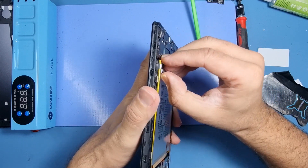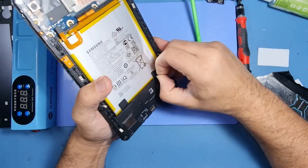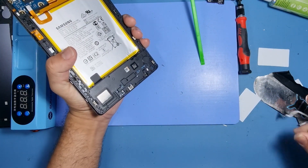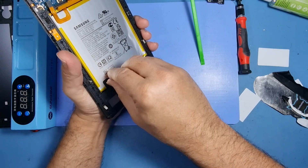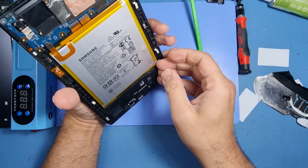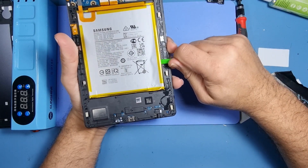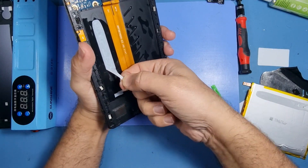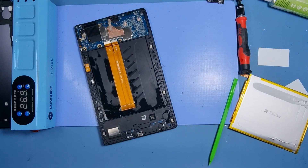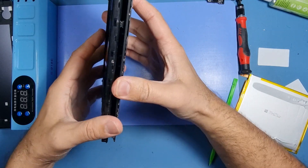Got a frame here to remove — this frame needs to come out. Let's disconnect the battery and also disconnect the connectors for the screen. Got a few screws here to remove. The video is a little bit long, I suppose, but when you're doing it, you kind of will avoid some of the pitfalls that I've come up against — so it'll be a lot easier for you to repair. Disconnect the battery — don't use metal. Use a plastic spudger tool or something that's not going to damage anything. The battery is bonded in. Use a bit of alcohol just to get in there. I think these pads — if we just pull this tape, we can just pull out the battery. That will release the battery. We don't need to get any alcohol. Afterwards we'll put some double-sided tape in and bond it down that way. Remove the flex cables from the chassis, the frame.